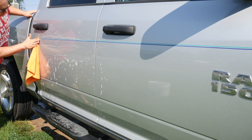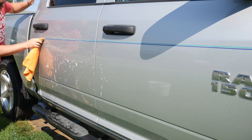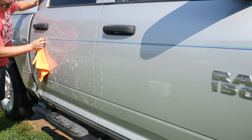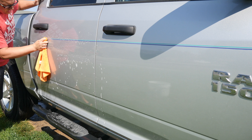I did some research on this and lacquer thinner should not hurt a catalyzed clear coat. Most newer cars do have a catalyzed clear coat. Now if you're worried about this harming your vehicle, I would try it on the interior portion of the door maybe a few weeks before you actually take the project on, just to see how it reacts.